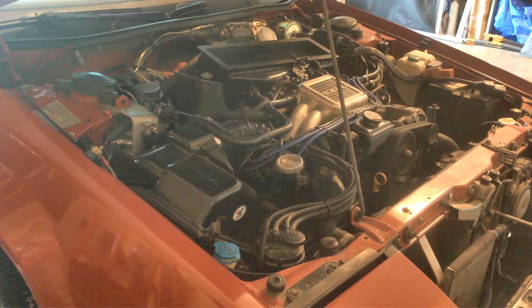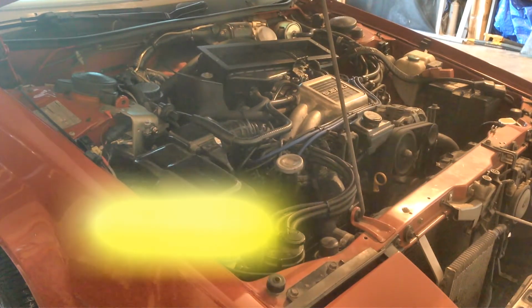So now the power routing system's all set up for the injectors and the coil, so that it only turns on with the fuel pump relay. So we can't get any feedback and dump all the fuel into the motor through the injectors, and we can't get the coils firing at an inappropriate time because of the backfire. So I guess we're ready for the next step.